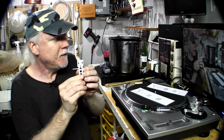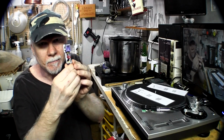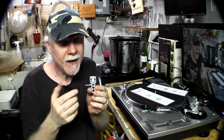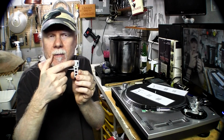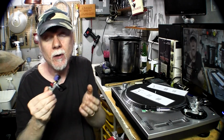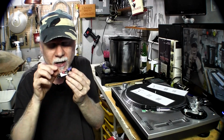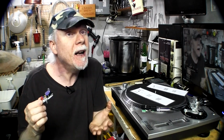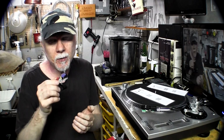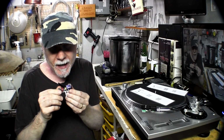Here we have a phono cartridge, okay? And most of the head shells that you can get have a range of places where you can actually mount the cartridge. You mount the cartridge in there, you connect the little wires. It's a pain in the butt. It takes a little bit of time. Get yourself a nice, large, clean area with lots of light. Get yourself a beer or a coffee, whatever it is you prefer, and take some time to do this properly. It can take a while.